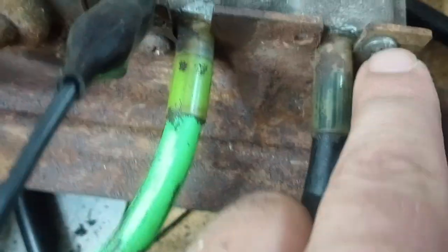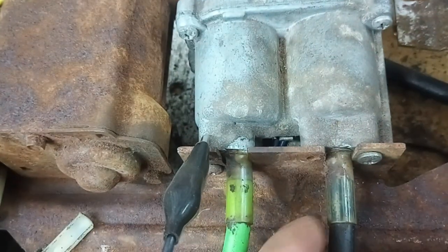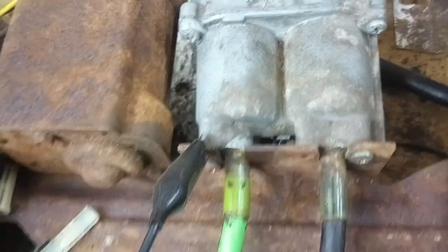The flex drives are pretty easy to access when you take the transmission off — just these two bolts, and the transmission comes off. Then there are little metal collars that hook to this metal plate; you just slide them up and they come out. Over here it's like a speedometer cable — it's just a nut that locks it down to the worm gear drive. So I still need to do a little more cleanup on this. The track needs some lube — the track that slides it forward and aft. You can see the gear there; I'm going to get that lubed up.